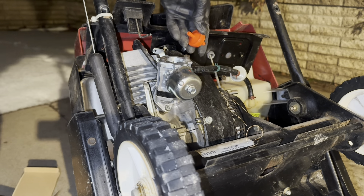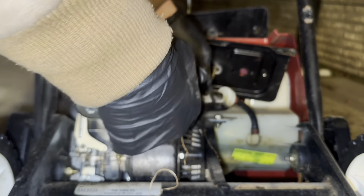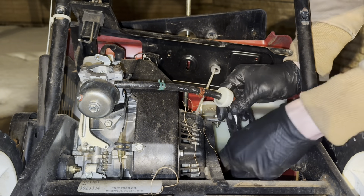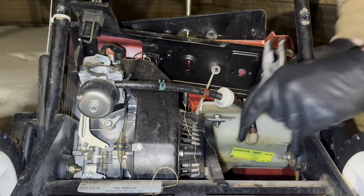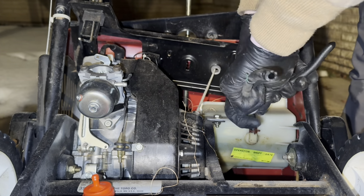The pack that I purchased did come with a new — I think that's a gas line filter, honestly not really sure — but since we have it we might as well put it in. We're going to take the clamps off, pull the hoses off, and then replace that piece. The smaller bit is going to go towards the fuel tank; the larger side is going to go to the carburetor.